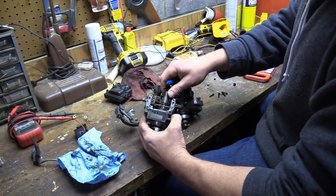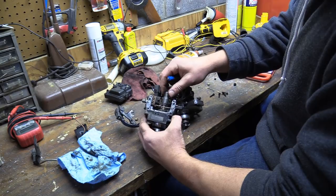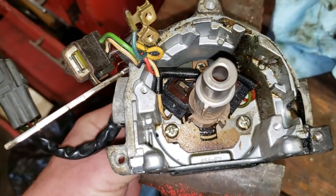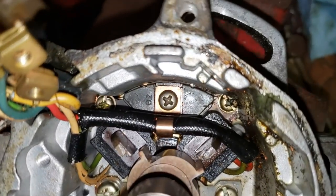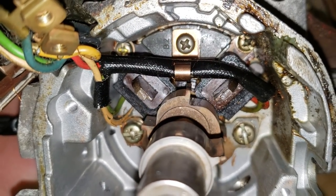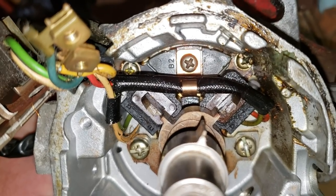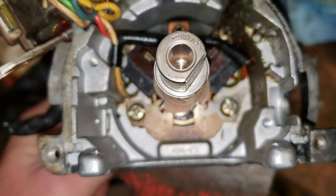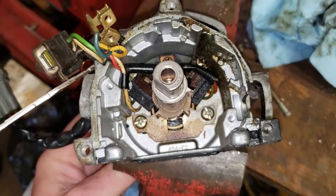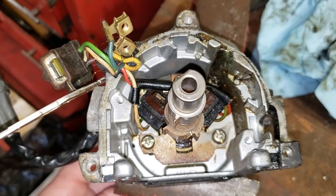So it's the cam sensor signal that was missing. That's why the car was still able to run — basically the injection timing for sequential injection would have been off. Clearly this car can run without the single pulse cam signal. The four pulses per rotation — those teeth down there — that's what gives you piston position and RPM. That's why the car was still able to run. The cam pulse would be used for number one injection, and the computer can fire in firing order sequence without that signal. It was running in a default strategy with the injectors, whether pair or group fired.